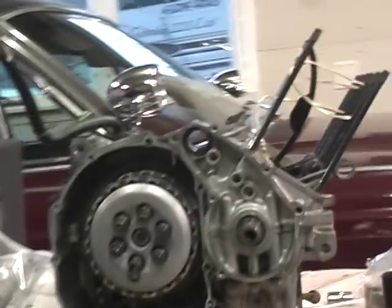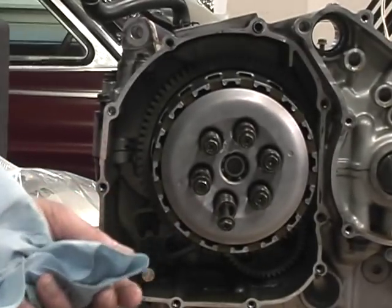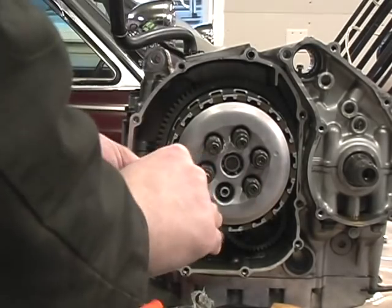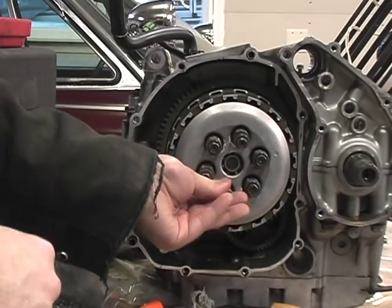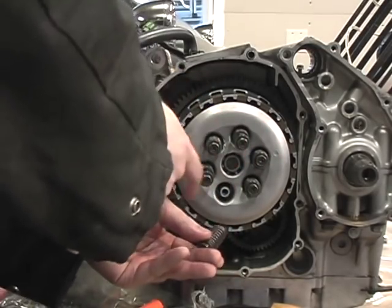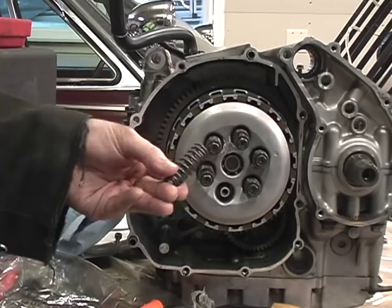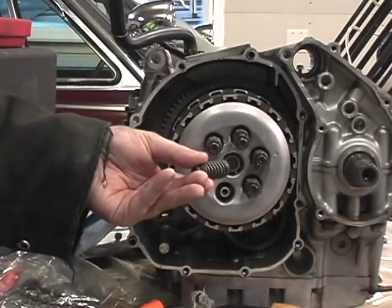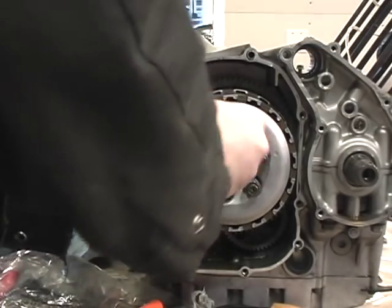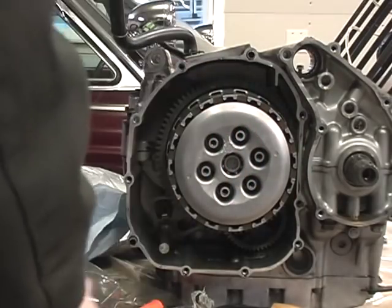I have these loose — let me get you a better angle. See, the springs are starting to come out. I'll remove this and the spring will come with it. Stock 97-plus YZF has long and short alternating springs. It doesn't matter where you start as long as they alternate — short, long, short, long, short, long, or vice versa. 95 and 96s all have long springs stock. I have an EBC clutch kit, so regardless of the year, if you have the EBC, they're all the same length springs and can go back in any order. I'm going to bag these so I don't lose them.